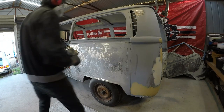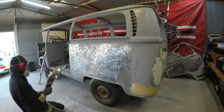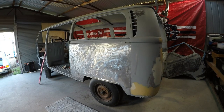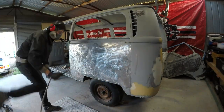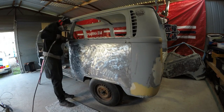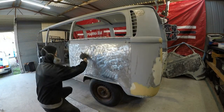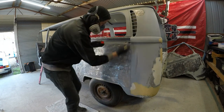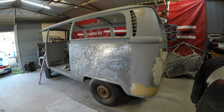Just after this is filmed, I go around the car about 4 or 5 times, putting some nice big heavy coats of paint on there, and you leave it for about 2 weeks and it shrinks into all the cracks. Then you can sand it with a finer grit sandpaper and a long straight block, and it blocks out all the panels. It shows you where there are any imperfections or misfits. So I did that a few times and got it pretty close.